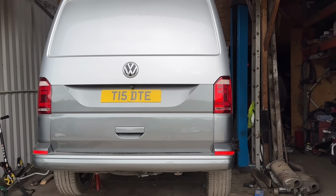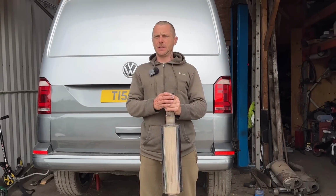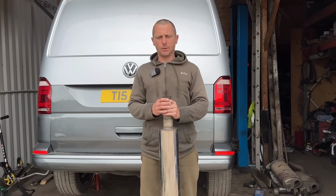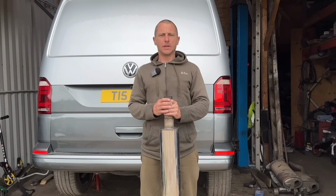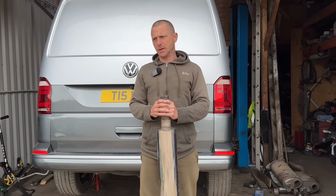My man came to help with the AC on the caddy. He degassed it, fitted a used pump. Reason for fitting a used pump, it was either a new Chinese pump or a second-hand genuine one. Went for genuine, pulled the gas, fitted the pump, put the gas in. Aircon in the caddy is absolutely freezing. Big shout out to my man Kirk, who comes out and helps me out.